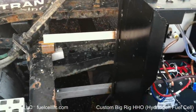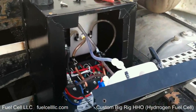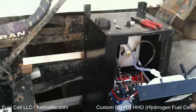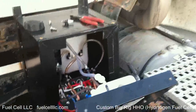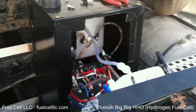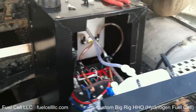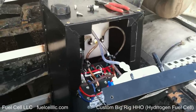This is kind of a jury rig mount. I was going to mount it on a side box, but this truck has skirts and I couldn't get up under there, so I just rigged that up and welded on some stainless steel. In the future, I'll normally mount a box with clamps on the sides, just mounted right to the top of the frame. For longer extended frames without skirts, like Peterbilt's, you just pull off the step and mount the step to this box itself, and this box will be side mounted on the frame. It'll probably make it a little bit more compact.